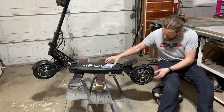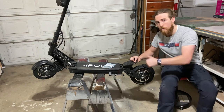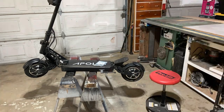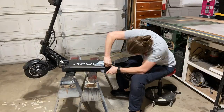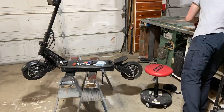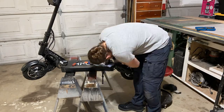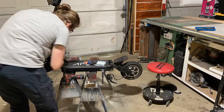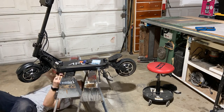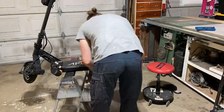This is a wheel bearing and this is unacceptable, so we're gonna swap them out and see how much better these are than the stock one. No matter what company makes your scooter, they're all basically made by the same people, so the process is pretty similar across the board. You're gonna have to remove front access plates, back access plates, disconnect the connector for your motor and the controller leads, and pull them from the front to the back.